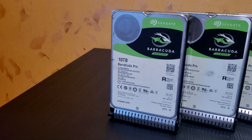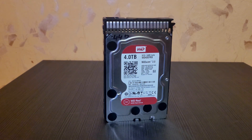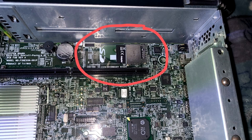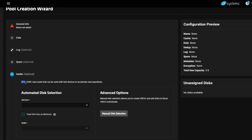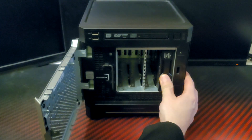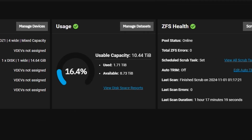Here is the set of hard drives I've been using: three Seagate BarraCuda Compute 10TB drives and a single 4TB WD Red Plus. I bought these refurbished, so it's cheaper — about 100 euros for a single 10TB drive and 40 euros for the WD Red. I'll also take advantage of the internal microSD slot and install a 16GB Samsung microSD card for ZFS log cache to make write speed a bit faster. I installed the drives into the drive bays and configured them to run a RAID-Z1 configuration — three drives and one parity drive for safety. I know I left a lot of space unused because of the one 4TB drive, but in the future I'll expand this pool when I run out of the 10.44TB, because we're talking about budget here.